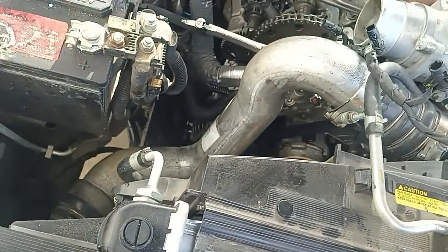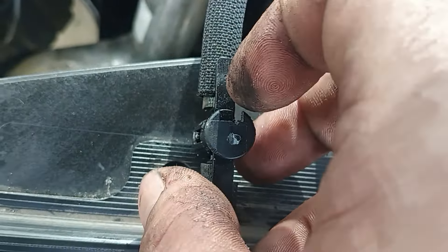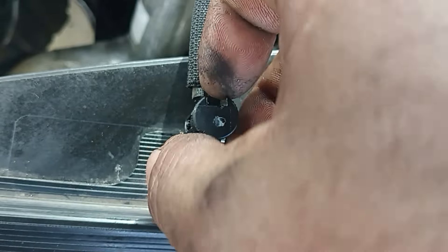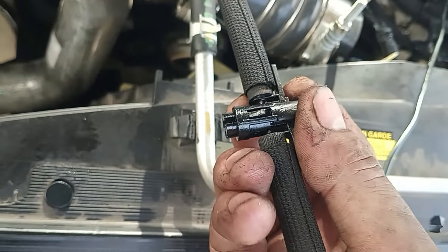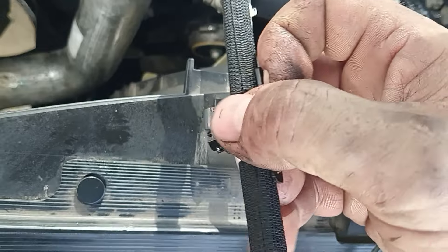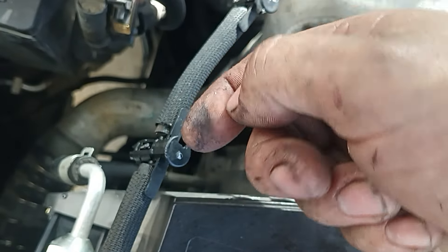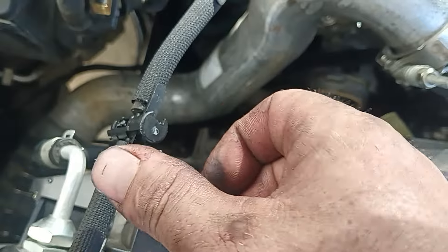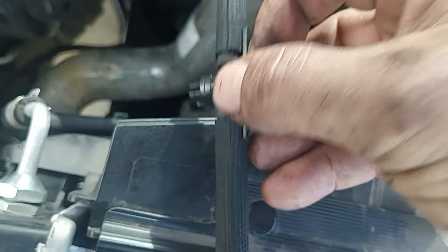The part that is kind of a pain in the ass is these return lines. I get a little screwdriver and get it in here and give it a little pry. You're supposed to push down on both of these and then this pops up. So get the little clicky thing in there — it is a pain in the ass. Put a little pressure on it with a tiny screwdriver, push this down, and just kind of twist the screwdriver at the same time and it will pop up.